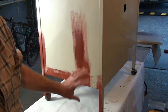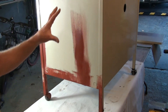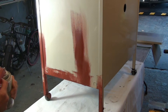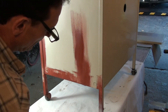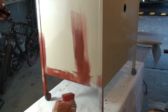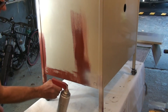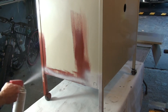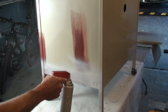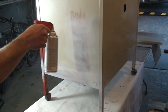I'm repositioning to work the sides without messing up what I already did. This side just has some spotty areas of the red, so the plan is to spot these with the white. On the second and third coat I'll do the whole side, but right now I just want to get some white pigment on top of this red to start hiding that color. I'm clearing the can first, then stopping and starting, not blowing paint into space in a wasteful manner — just continuing, never going back, covering with a light coat.